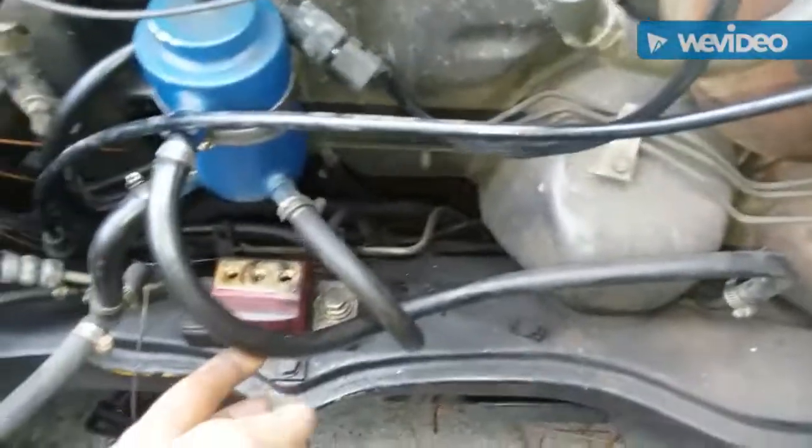Alright, we got our exhaust gasket on and our DC Sport header. It's time to roll it over and get in position. I'm not even worried about how dirty this is. I'm just ready to get this in here. But that's how I got my power steering re-looped. It feeds the rack, also goes to the transmission thing, but just pretty much re-loop the lines to the rack, to this reservoir, to the high pressure hose.